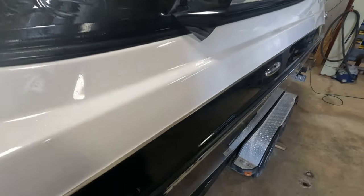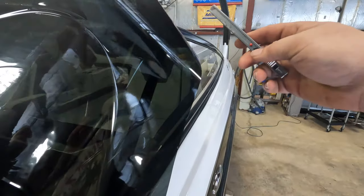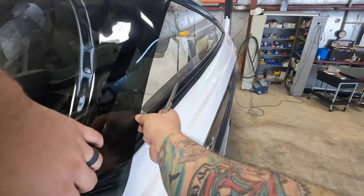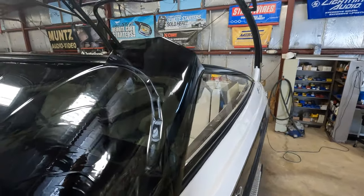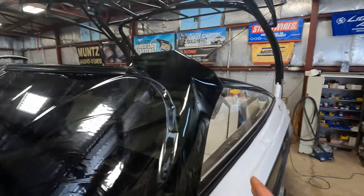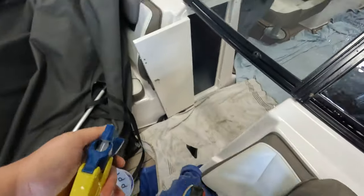So now when you're at this point, you're gonna go ahead and take just a little bit off the top of this - you want to leave it long there. And you want to leave it long on this side as well. Now you've got to think about it: this glass is a quarter inch thick. When we take this pattern to the inside, if we were to trim it all up on the outside, the pattern is going to be a quarter inch bigger on the inside. I need to take it to the inside.